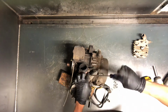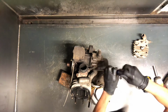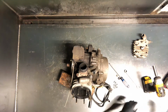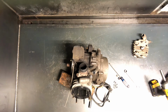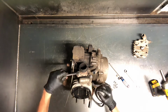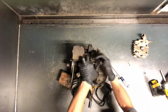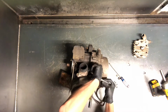And a Phillips screwdriver to remove these 2 clamps here. We've got the exhaust manifold here. There's a donut gasket that goes there, and those are pretty common that they go bad. Got a 13mm nut on here to take this manifold off. Wouldn't have to do this manifold now, but maybe we'll finish pulling this cylinder and then worry about that manifold.